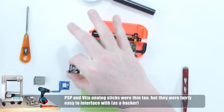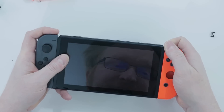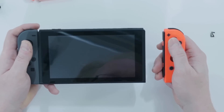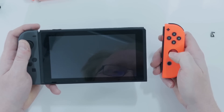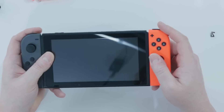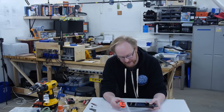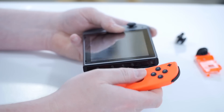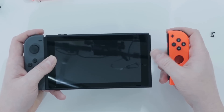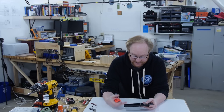This is so unconventional a design, I'm not sure we can replace this with a standard analog stick. What we might have to do is take this stick and move it, instead of replacing it. So I'm thinking we make some kind of spacer that goes between the Joy-Con and the switch. The problem is your thumb wants to reach the right analog stick naturally. We could 3D print a matching plate that slides into the switch, design the piece that goes in first, make sure it fits, then build out from there — male and female connectors to link them — no more than about one inch wide.